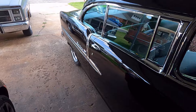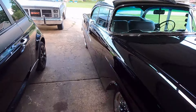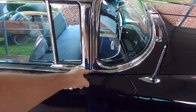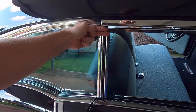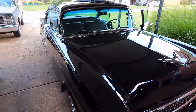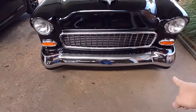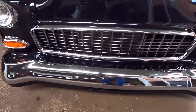I took the marshmallow-on-a-stick effect out of it, where every panel had a crown hump in the middle. I heat-shrunk all that, reworked all the jam edges, reworked the door edge and fender edge, and now it has one crown that starts at the headlight and goes all the way to the back — no triple bulge. I went out of my way to make all the stainless fit perfectly with the same gap. I also used part of an original bumper on the bottom, cut it down, sectioned it, built brackets — it's mail-slotted and that's where the trans cooler is.